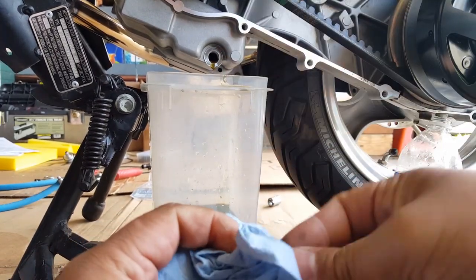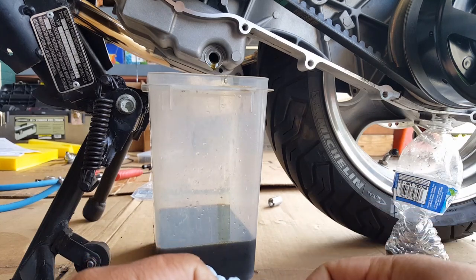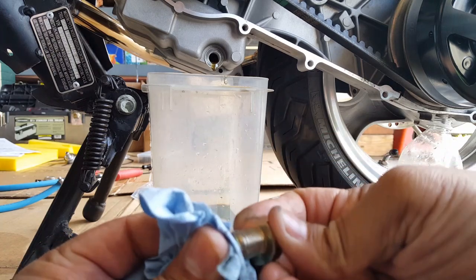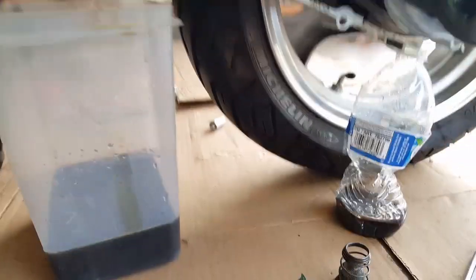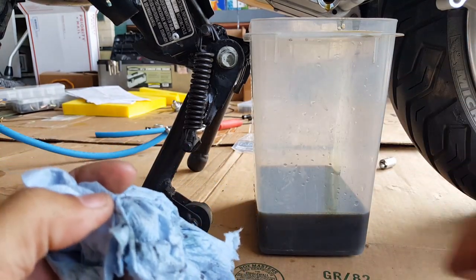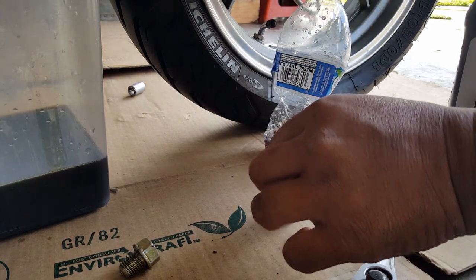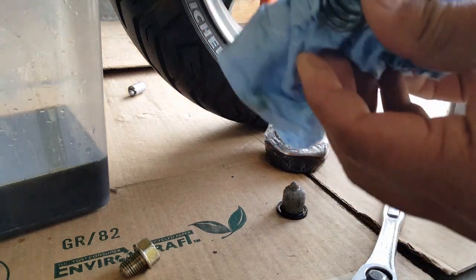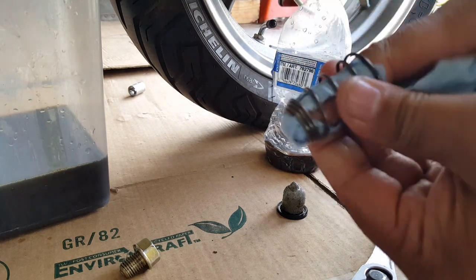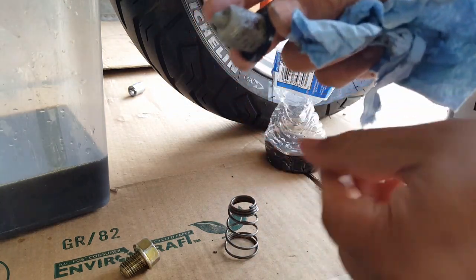The washer is still pressed on there, we'll just leave it and wipe it. I'm going to shoot a vacuum — here's another trick to get all the motor oil out, especially all this gunk. I could shoot the vacuum out this way. We've got gear oil filling up as well. Just let that all drizzle out while you're cleaning. Continue on — clean this guy. You can take it and maybe spray some brake cleaner or parts cleaner too if you want.